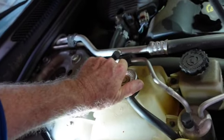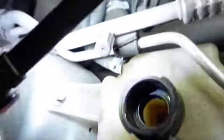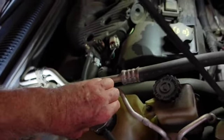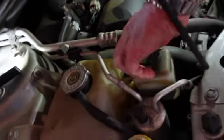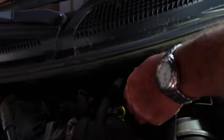Never do this at home, kids. This takes 5W20. Have you looked at the oil? It's good, it was changed before I got it. This takes that pink stuff - you've got to remember you can't mix them up. You got your organic and inorganic coolant. If you want some washer fluid - there's your AC, that's where the high side is. Power steering's good. You check the air cleaner - looks good. What's your brake fluid look like? It's good, pretty clean.